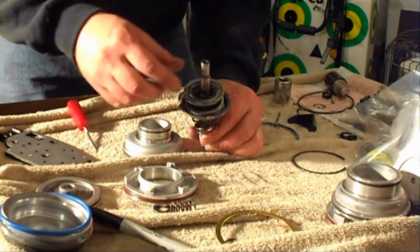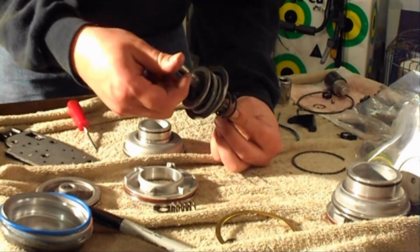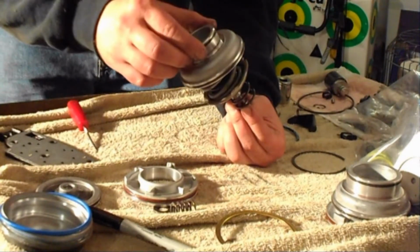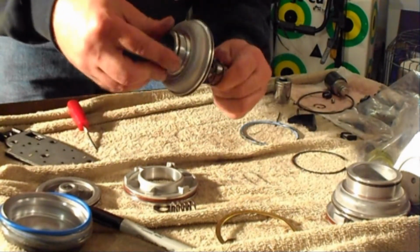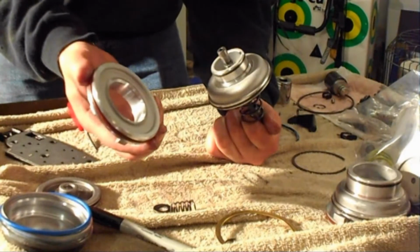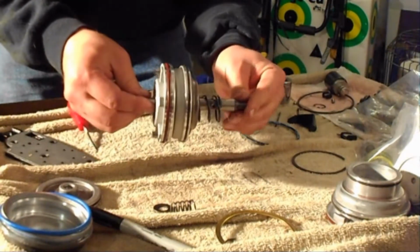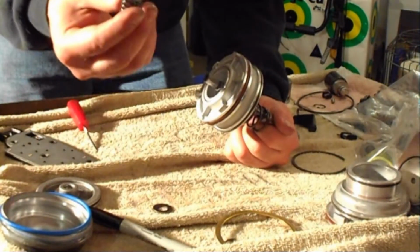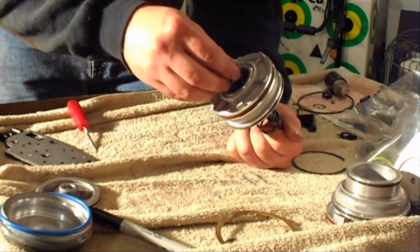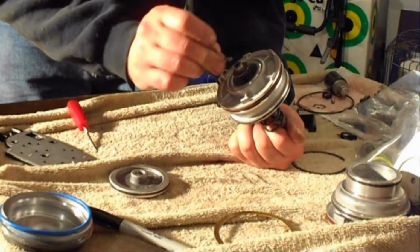Before I do that, in order to take my old second piston off, it had formed a rim around the edge of this valve, so I had to use real fine sandpaper, just sanded it off enough to get this second piston off of it. The new one goes on without a problem. Then they go ahead and assemble the new housing. These notches face to your left, my right. And you got a little spring that you stick back on there. You got your shim or washer that goes on there. And then your snap ring, your E-ring holds all that together.